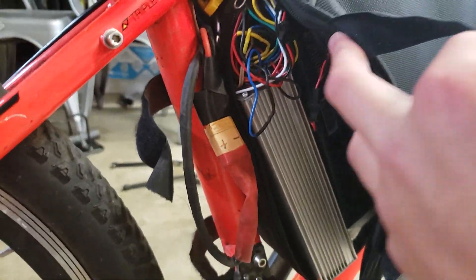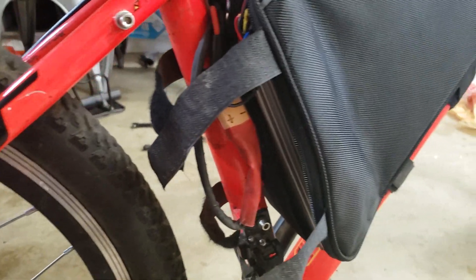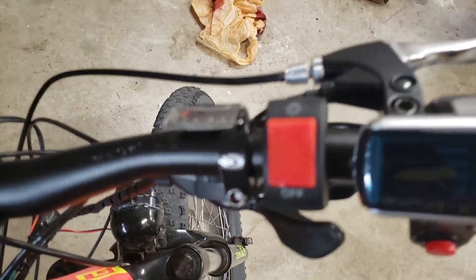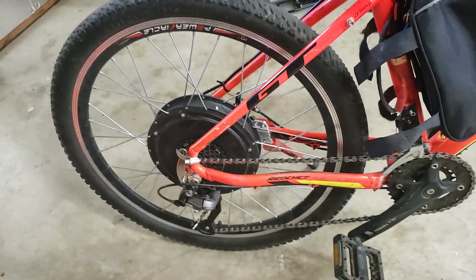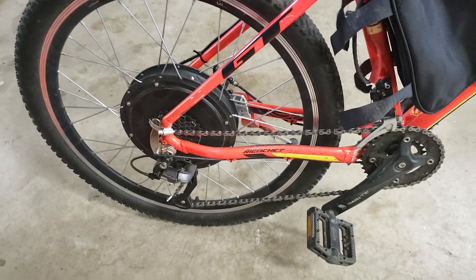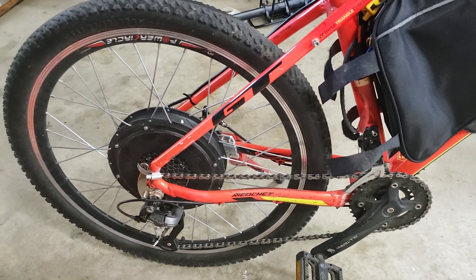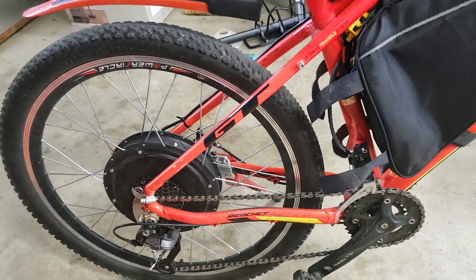This little blue wire — if you connect the two blue wires it limits the motor to 750 watts. I wanted a switch on my handlebars for that, so that's what this red switch is for. In the off position it runs at the full 1500 watts, and in the on position it's in eco mode at 750 watts. There's about a 10 mph difference — around 25 mph on flat ground at 750 watts and about 35 mph at 1500 watts.